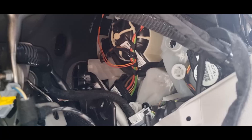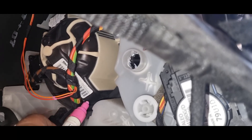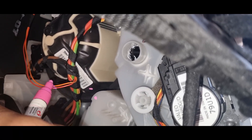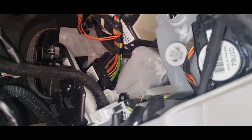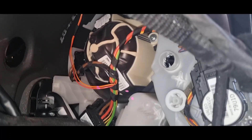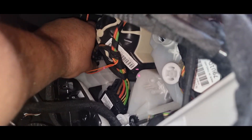This is why we need to remove the glove box — so we can have access to the blower motor. I usually put a dot or some sort of indication of the lock position of the blower motor, just so I can know when I put it back on how it should align. But with this video you won't have to, because you'll see what you need to do.